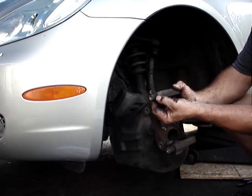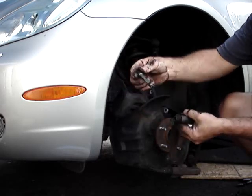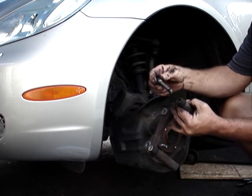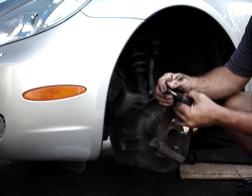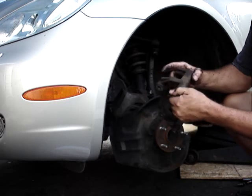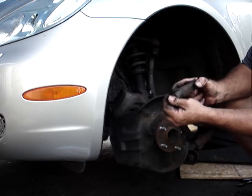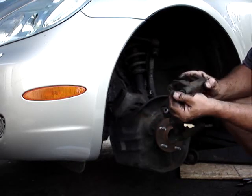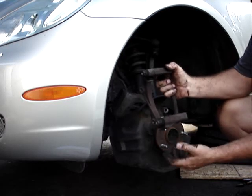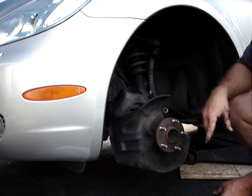It is just a boot — you can peel the boot off and they'll pull out. You can re-lube them, clean it out inside if it's rusty. Put some more lubricant. If the boots are ripped and that's why it got rusty, make sure you replace the boot. They just snap back on as easy as that. Keep them pushed in so I can put the caliper back on. At this point we're all set with the holder — this one's pretty cleaned up.